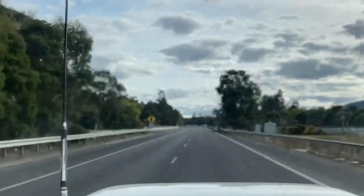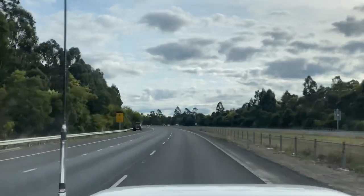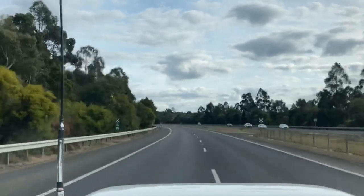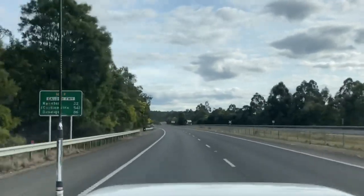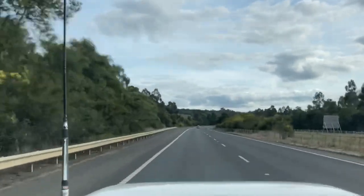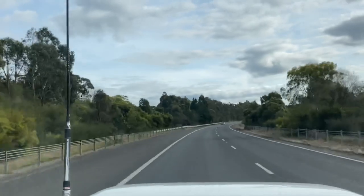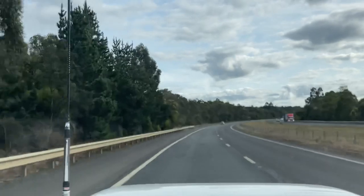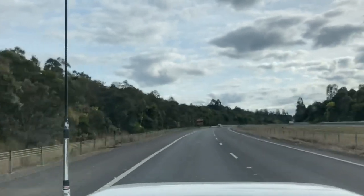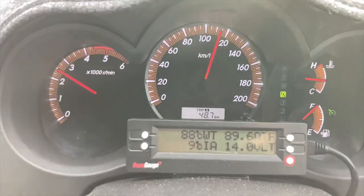I can resume the cruise control, set it, move over. There's someone else coming on who can't do the speed limit. I'm going to move back again because they can't do the speed limit. Anyway — two and a half thousand revs in a Hilux at full speed with standard size tyres, what you're looking at is a lot of heat. 92 degrees — that's what's happening, it'll just keep going up to 100, 110, unnecessarily.